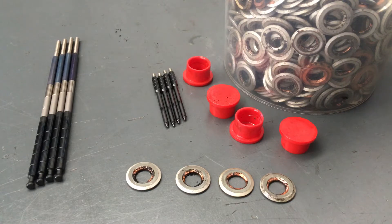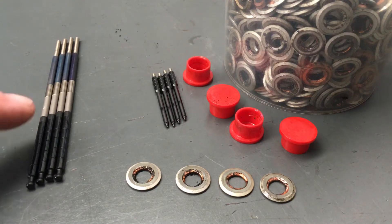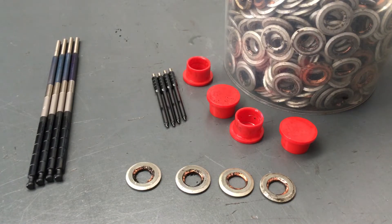All the old wearing internal parts — we've mentioned this before — on the command piston, which was a big problem causing injector sliding malfunction, doesn't seem to be happening with these. We're not getting the bad readings with these injectors like the old ones. So you've got to be careful trusting diagnostics.